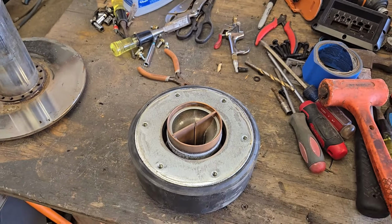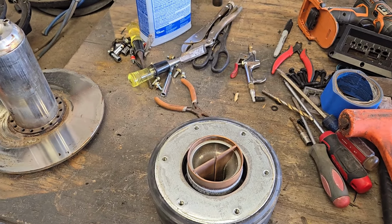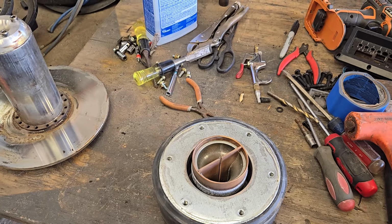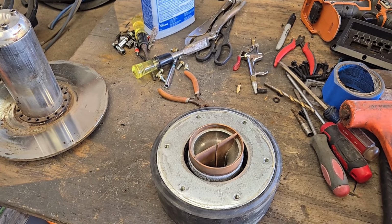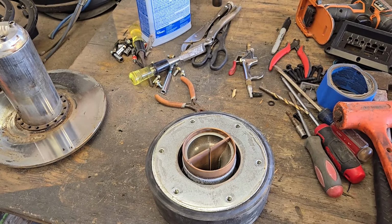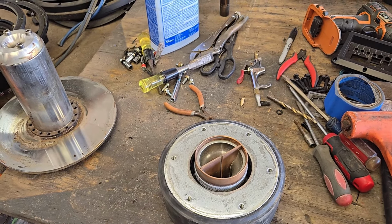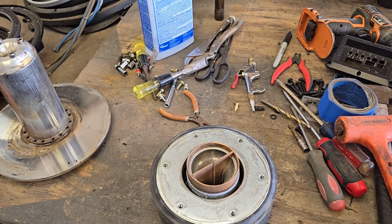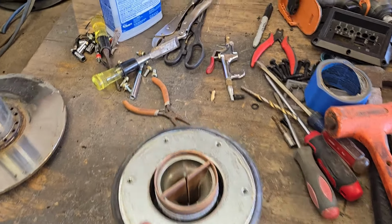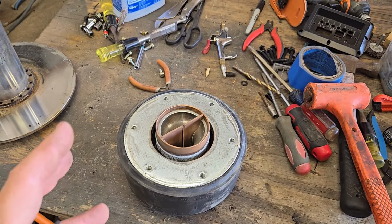Most of the Chinese patterns will be, I don't want to say even, but they'll be like 160 or 165 or 150 or 155 in increments of 5 millimeter. Now, typically when an American company, like JL, where all their stuff is made in China, wants to make it seem like it's made in America, they'll use an American standard. Always convert to metric. On the 13W7 we figured out that it's actually 161 millimeter. Whatever that comes out to as far as standard, it's probably like 6 3/4 or something like that, but just keep an eye out on that. And then of course this is standard hardware, which is M6. By telling me the bolt hole circle, it tells me what frames are available for it.